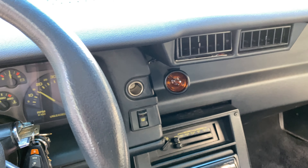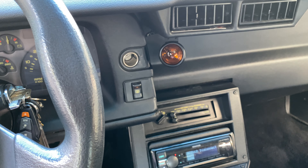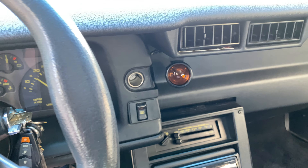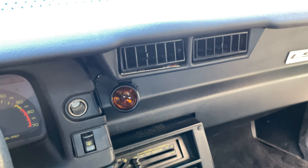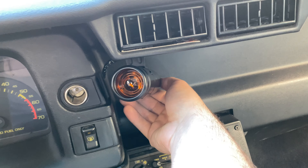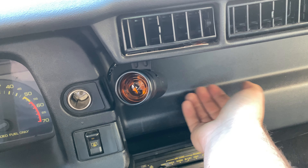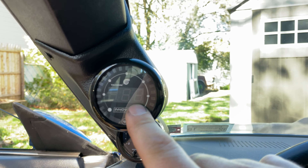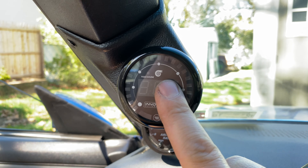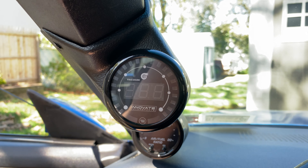I have it set really really low now and when I give it some revs it is working — I just need to dial the RPM in. It's going to be a little difficult because the dial on the back is very very far off. I have it all the way down below 4000 and it's not coming on until above 4000, so setting this to 6500 isn't going to be accurate. I think that's why the old one wasn't working — you go in with the laptop and program it, I had it set to like 6250 and it wasn't coming on. If I connect the laptop and dial it back to maybe three or four thousand to actually light up, I think it'll probably work. It might be a resistance issue or something weird.